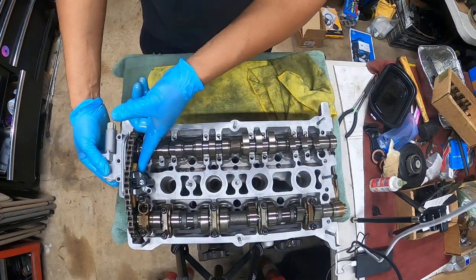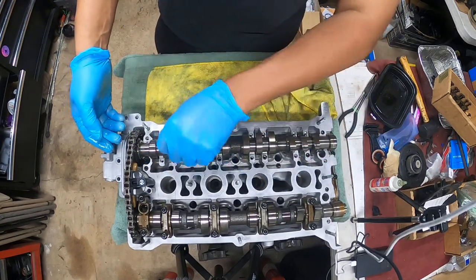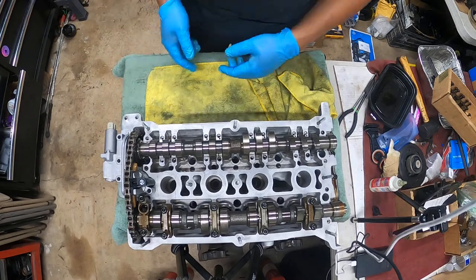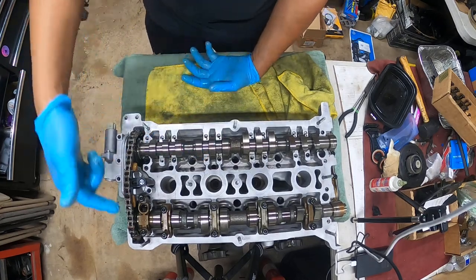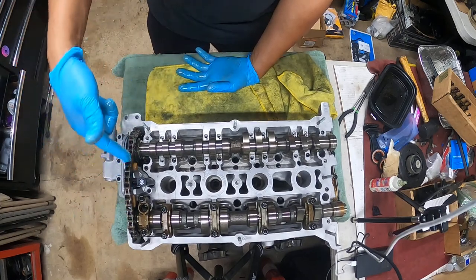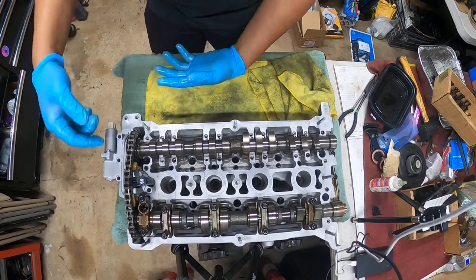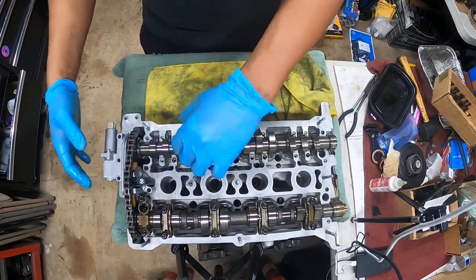What really matters is the tensioner and the intake cam coming off, because you have to rotate it to get it back in. Exactly. Wiggle it just a little bit and it'll get in. I guarantee you, you just watched it go in. The chain is set distance. You can't change its distance at all. What's giving you the ability to do that is the tensioner here has slop up and down, and that's what lets you put it in and wiggle it around until you get it in.